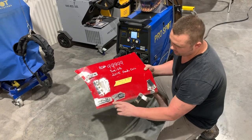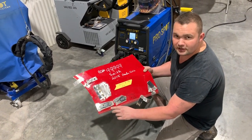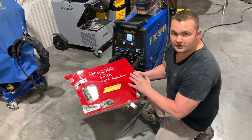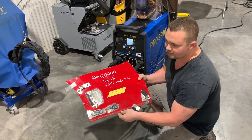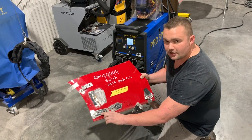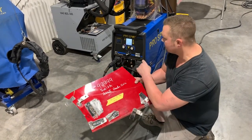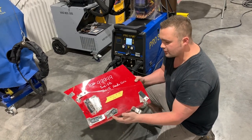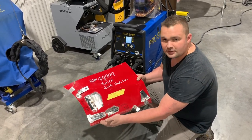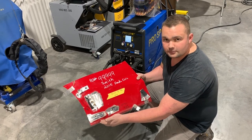Right here we have a three-panel spot weld and here's an example of the destructive test weld. What I've noticed is these smart welders anymore — they change voltage and amperage as you're welding to make the weld as best as possible. So if you're doing your weld on this panel and then you start on the car, you can look at the voltage and amperage that it's putting out and make sure that it's the same as what you came up with on the test weld.